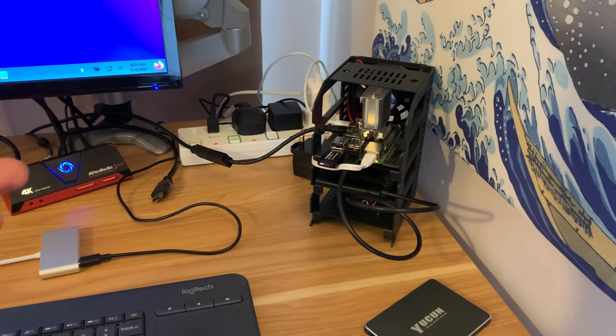As I say, I'm only doing this because it's easier, because it's all set up for remote desktop and everything. But if you wanted to do this, because of the lack of any extra USB sockets, if you're using USB boot, obviously the gain, as we've just seen, is from a much faster operating system, because the storage is a lot quicker on an SSD drive, and I think it's going to prove on a USB stick in a minute. But because you don't have any extra USB sockets, you can't plug in a mouse and keyboard, so you need remote desktop. So this video explains how to set up remote desktop in a headless mode, so you can basically set up your Pi, and then straight away you can pick up an iPad, an Android phone, a MacBook, a Windows computer, and you can control your Pi headless, and then you can set up your Bluetooth mouse and keyboard. So that's the state that I need to get it to so I can do all these tests.